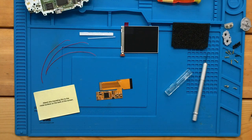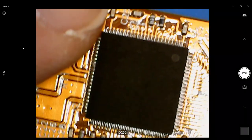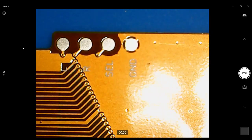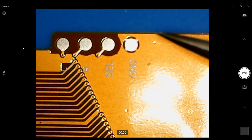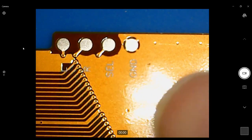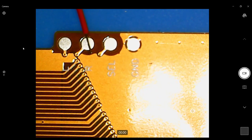You can see the little pads here — maybe we'll get this all under the microscope. You can see here the little circuit built right under the ribbon. Here are our controls: we've got a ground which we don't use, a select pad, and a right and a left. We will attach these — looks like 30 gauge wires — and solder it directly on here. Then we can connect those to the board.